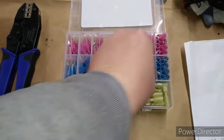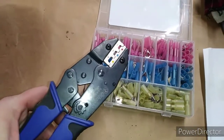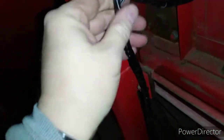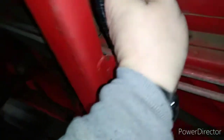We're going to begin with some terminals that shrink-tube onto the wire, and we have our crimping tool here so we get a good, lasting connection. What I've done now is re-wrapped this wiring harness in electrical tape — that's what they had from 1975. It still has red paint on it in places, so I think it should be sufficient for the next several years.